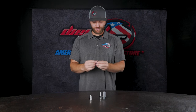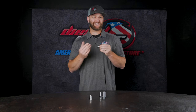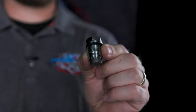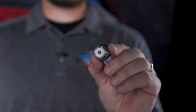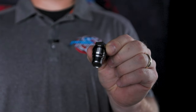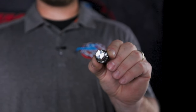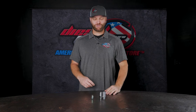We've got another example right here that illustrates it a little bit better. This is another rail that you would find maybe on a 6.7 Cummins. You've got a hole right here on the side, and there's a spring and check ball, and it relieves the pressure from the bottom. Race plug — notice there's no holes on this little shoulder right here, and there's no hole on the bottom. So by replacing this, you will never lose pressure on your rail, unless you're not making enough pressure or you have an injector hung up, in which case you're already dealing with bigger issues.